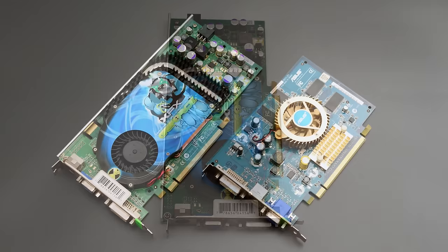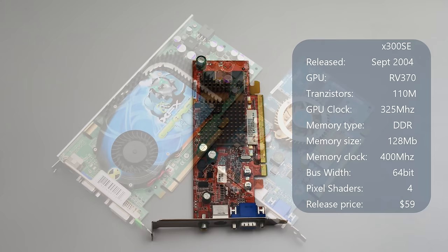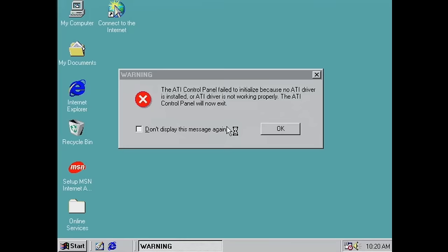The driver I used for both cards was the unofficial 8269 that allowed me to install these cards. None of the official drivers recognized these cards, and probably NVIDIA had a good reason for that. On the Radeon side, I used the 6.2 WME driver that created absolutely no issues for the X300. The X850 was problematic, to say the least.